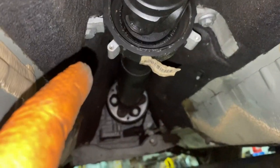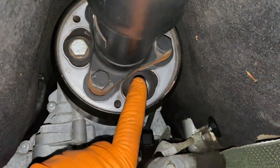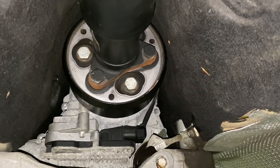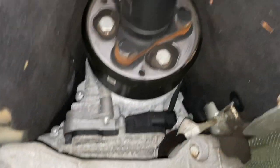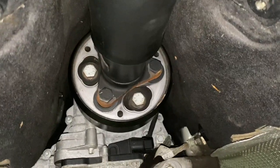The center support over here looks like 13 or 14-millimeter bolts — just take those two out and let it hang down. When you get to the front, it's basically the same thing — they're all 18-millimeter. You just take off these three, and if you can't get the fourth one you'll need to turn the driveshaft. I have a video on how to put this car into neutral — it's not easy. There's a mechanical lever you have to push up. So I can get to these three; I'll take the driveshaft out and show you what it looks like.